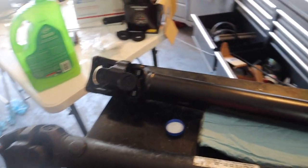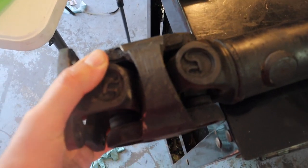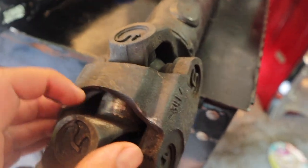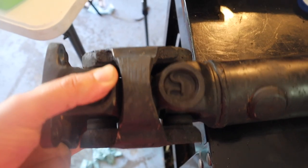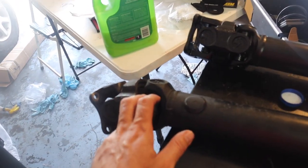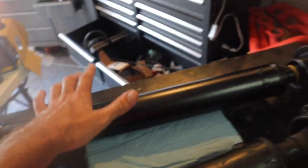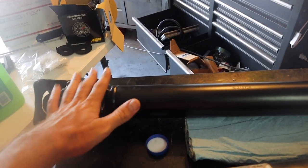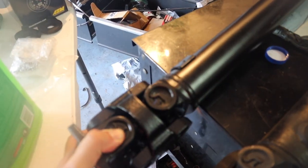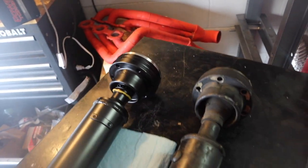Also what we've got here for the ML55 — I took out the front drive shaft because I was getting a loud clinking noise. Right in here it's all blown apart, so I have so much play right there. It's not that big a deal — this is a 20-year-old truck, so it's got a little play. I found a rebuild kit for this and it cost roughly $120. Or what I got was brand new, shipped to the house in two days, for $140 — and it has a 10-year warranty on it. No play at all; the joints are so much stiffer. It saves me so much time not having to rebuild it.